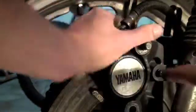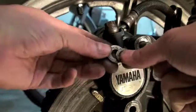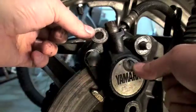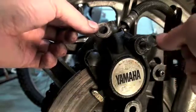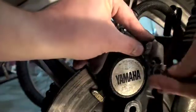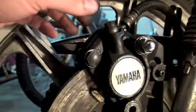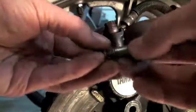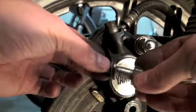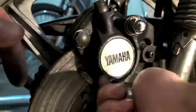So now we're ready to go. I'll just reinstall the washers and nut again. Just a little note on that: the flat washer — the unbroken washer — goes on the inside. And the lock washer, this one with the split, the split washer or lock washer goes on the outside. The flat one on the inside, the split one on the outside. That's what keeps the nut from falling off. Now, if I was putting this together permanently, I'd put a little bit of Loctite or thread locker on it so it wouldn't come off. I like to do that with all these old bikes.